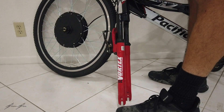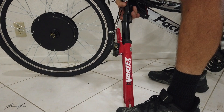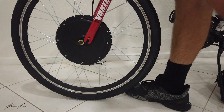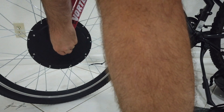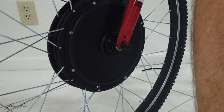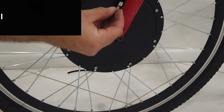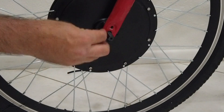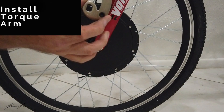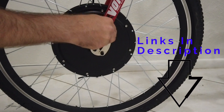Now we're going to install the front electric wheel — the motor. Make sure the cords are facing to the right — the power cords — whether you're doing a front or rear hub. I'm going to make sure the forks go on the correct side of the washer, with one washer on each side of the forks. I correctly set the wheel on each side of the washer, then put this washer on, making sure this part is in the opening. Then I'm going to install the torque arm. I also have a video on how to install the torque arm — check that out in the description below if you have questions about installing this piece of equipment.